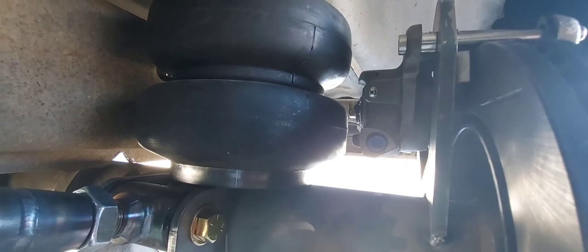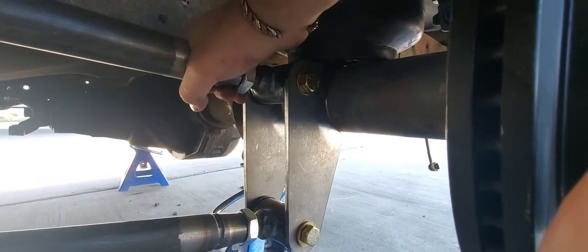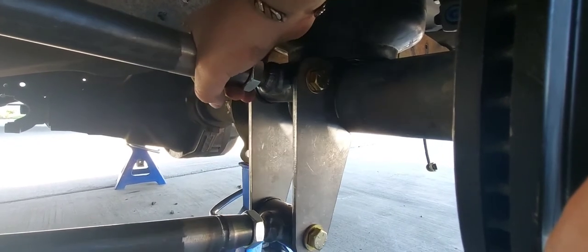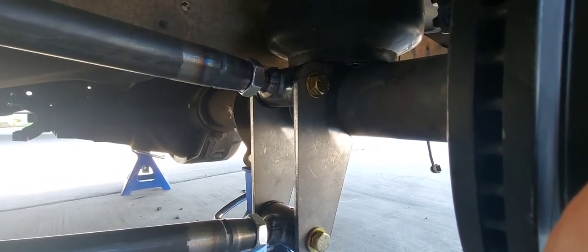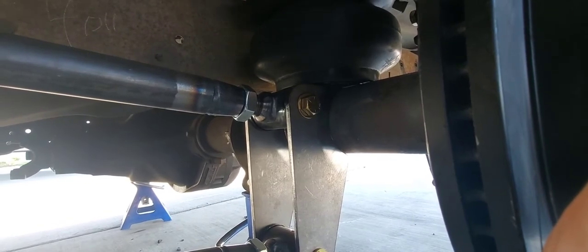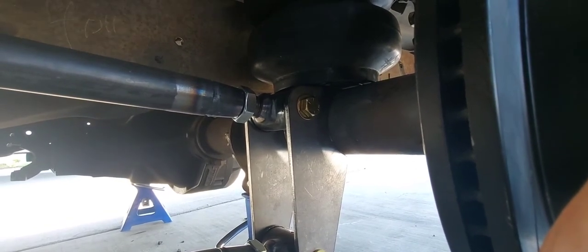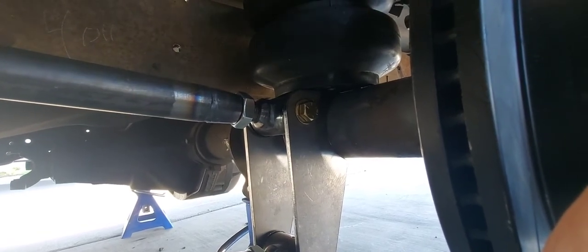Right now it's close to the caliper, like I was talking about before. I'm going to cut these tacks off and roll the caliper to the back side of the rotor to get clearance for the bag. The four-link brackets are not tacked in yet — they're just set in here for mock-up to lock everything up and get an idea of how everything's going to sit, with the airbag and the layout.